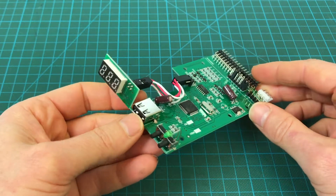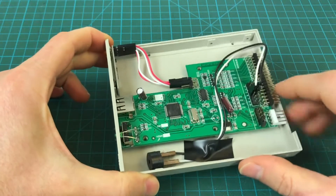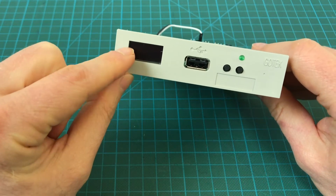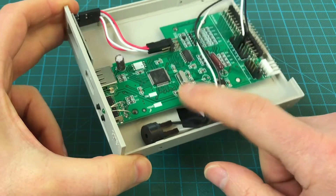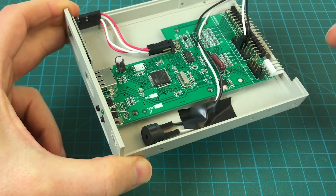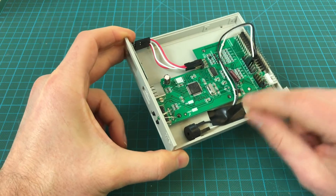This is my favorite way to set up the Amiga 500. This is a basic Gotek model the way it just came — it just has a numerical display and nothing else. I like to upgrade my Goteks to something like this, where I've replaced the numerical display with an actual OLED display, which is a lot friendlier because it will show the text of the disk image that is currently selected. The other upgrade this has is a piezo buzzer, so it actually makes a buzzing noise as the floppy disk drive emulator accesses things — like the seeking a normal drive would do. That feedback makes it feel a lot more like a real floppy disk drive. If you're interested in this kind of mod, let me know down in the comments and maybe I can make a whole video on my process and some of my other favorite add-ons for the Gotek.